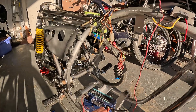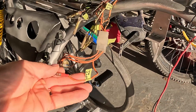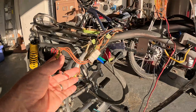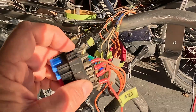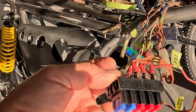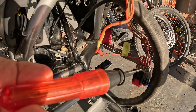This simulates my 96 volts right now. Since I haven't cut the fuse box where 12 volts go in and goes to the converter, I'm going to be able to test everything with 12 volts. Later we're going to add this converter in between, using one of the fuses that were never used that we disconnected on the original harness. It's so easy and so cheap — it just makes it a dream. There's no electricity going to it when the key is off.